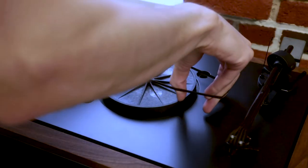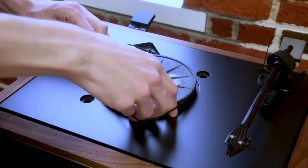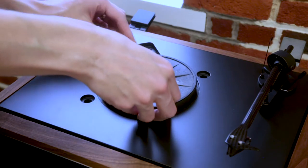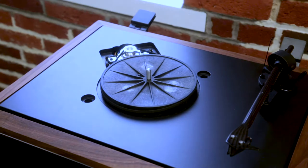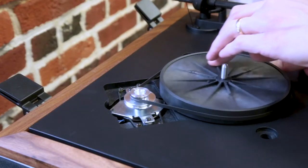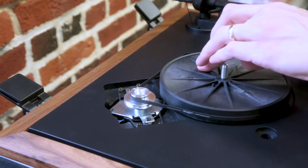After loosening and removing the two motor screws that are installed in the turntable, you can install the flat drive belt. You may do so by stretching it around the inner platter and over the top step of the small motor pulley.